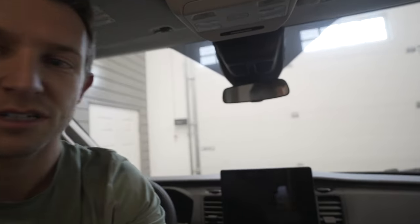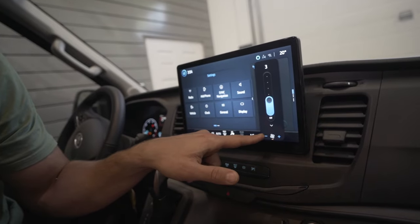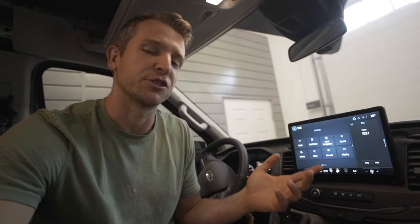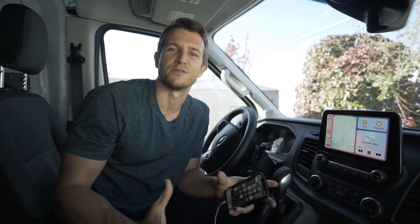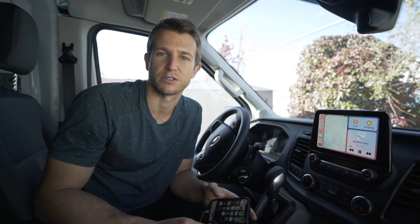This is Tim from the future — I'm here in a 2023 Ford Transit now. I had to re-upload the video due to a copyright claim from a company that sells those screens for roughly $2,000. I wanted to take the chance to show you the new 12 inch screen in the Ford Transits — it's a beautiful screen you can order from the factory, however you lose your HVAC controls on the dash, which I know is really important to some people. As far as I know this mod still works with 2023 Transits. I've heard of people ordering these vans with just the 4 inch screen so they keep HVAC controls on the dash, and then upgrade to the 8 inch screen like I showed in this video. Bottom line: approach this at your own risk — there is a risk of breaking your APIM if the software update doesn't go well. But to me it's well worth the $300 risk and I'm really happy with it.